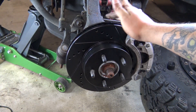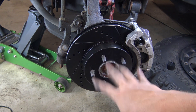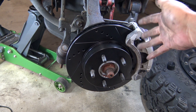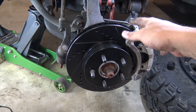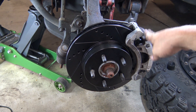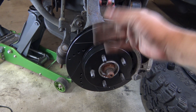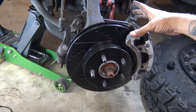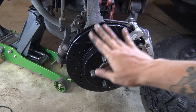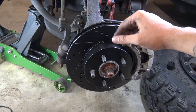So now we have our new rotor and our new pads, and we've cleaned up everything a little bit — and that's pretty much it. All we have to do now is bolt our wheel back on and torque it down. The one thing you have to remember when you change your brakes is once you get everything put back together, you start the vehicle, and before you put it in gear you want to slowly but repeatedly pump your brake pedal. What that does is tighten everything back up because you compressed the piston inside of your caliper, so nothing's making contact. Your pedal is going to feel really squishy and go almost all the way to the floor — slowly but repeatedly pump that pedal back up and it will be firm again. It is the same on the other side, just everything is reversed.